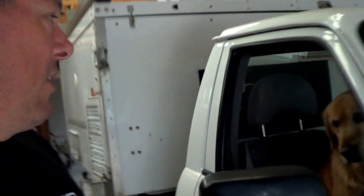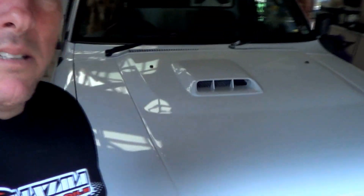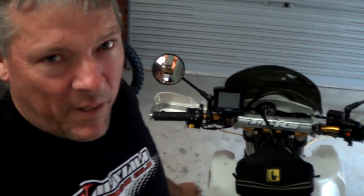That crane that was on the back of the tray - I ended up getting rid of that, sold it with the tray. I have to build another tray for the back to take this camper. The idea is just build a tray and I can throw the bikes on or whatever and go riding. Another thing I did before putting the Safari tank on is I changed the spark plugs. I put an NGK CR9s in, which is slightly hotter than the original CR10s that were in there. I checked the forums and a few fellas were running the nines. It made a big difference as far as idling and starting up - it just used to take a long time to warm up with the standard exhaust.